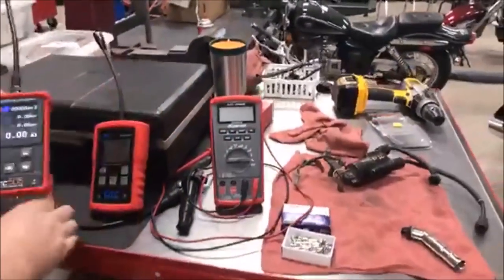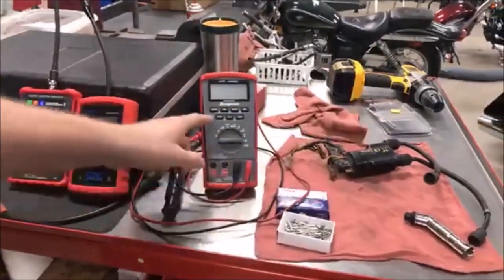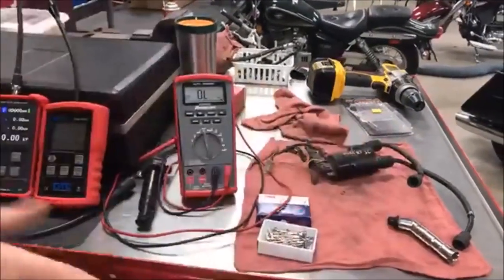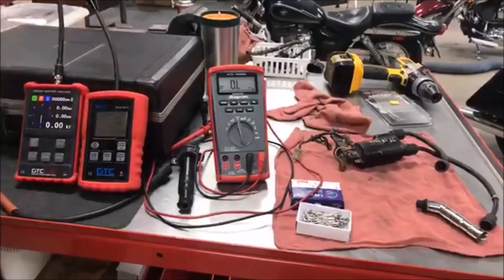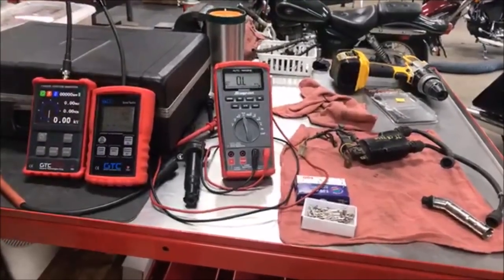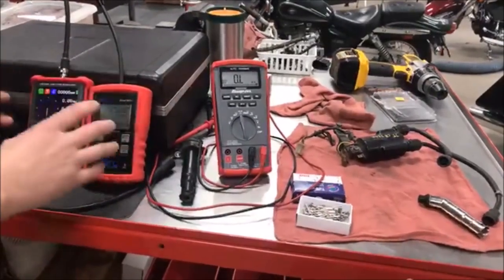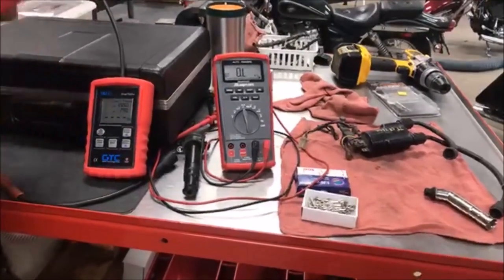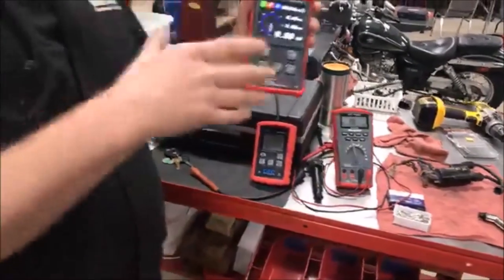As we're studying ignition and electrical systems here, this is so cool to see what options we have. Inside most all your service manuals, you're literally just going to take a meter and do a continuity test to try and determine. But this allows us on a running vehicle — or at least a motor that can crank, because the vehicle wouldn't have to run — we could just do cranking to see if we have spark. We can actually get some real live data. This is kind of like dynoing your ignition system. I don't know about you guys, but I think this is ridiculously cool. I'm really happy for GTC to reach out to us at HowToWrench.com and tell us about the new version of this.